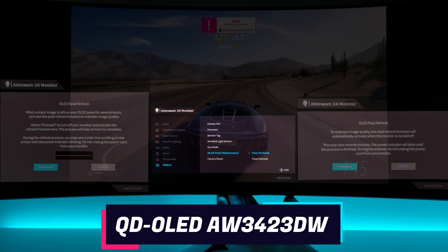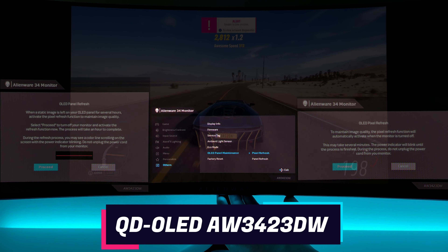It's leave it alone and do what you got to do — by the time you're going to play the next day, you're good to go. The pixel refresh automatically triggers after about 20 hours of usage. I use my monitor a lot — I extensively test, game, web browse, and edit. Usually when I buy a monitor or TV, I put it through everything I possibly can in those 30 days, because if it fails within 30 days, it's a poorly built product. Just like the manual says, every single day I do get a notification because I haven't disabled it yet. I'm leaving my monitor on over 20 hours per day for the last two weeks, so about every day I do see this pixel refresh. It does it automatically when you shut off your computer — you're not going to have an issue whatsoever. It's a monitor menu tool that helps you prevent burn-in.